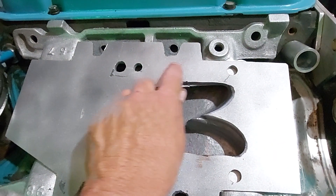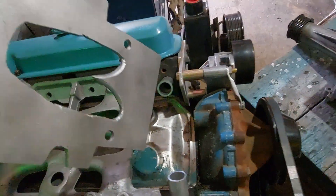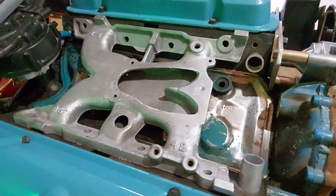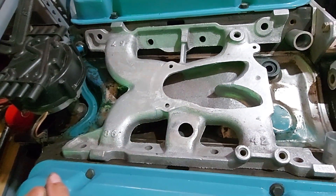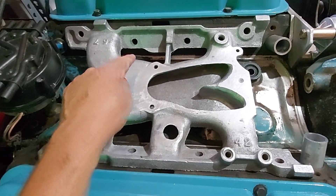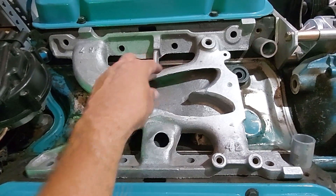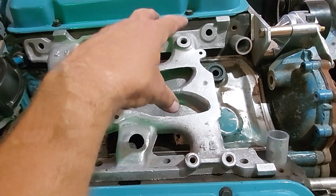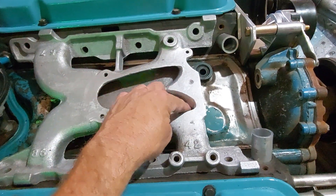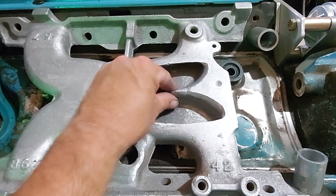The plate is heart-shaped because of the shape of the intake manifold. This is the Pontiac 301 turbo intake manifold — the turbo originally mounted right here in the middle of the intake. Of course I had to cut it for the supercharger since the supercharger outlet is more forward, so I cut it out as far as I could and tapered and knife-edged it so that it'll be a nice free-flowing intake.